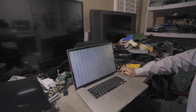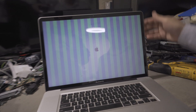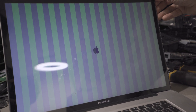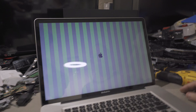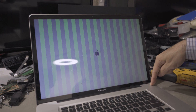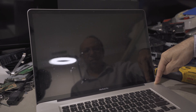The first thing we do when we get any laptop is we try it out and see what's wrong with it — even if the customer tells us what's wrong, we always make sure to try it out ourselves. As you guys can see, here are the pink lines which a lot of people get in these MacBooks. These are just vertical pink lines. Now we're gonna turn it off and start to disassemble the MacBook Pro.